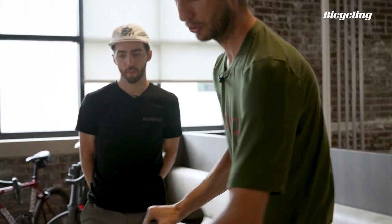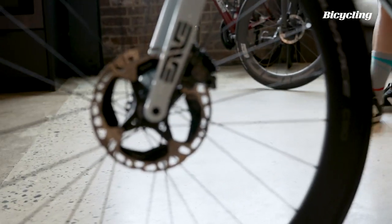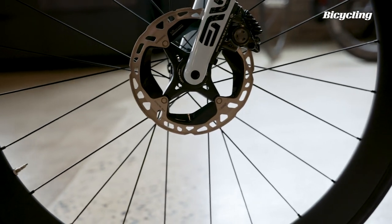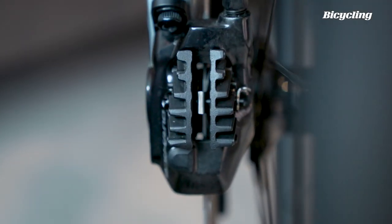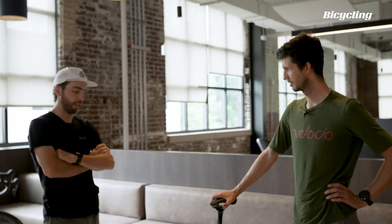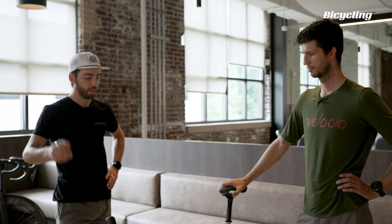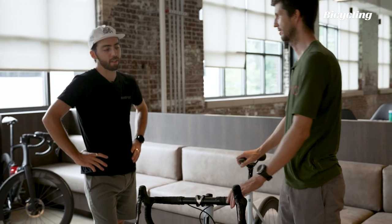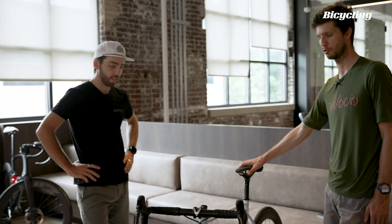The other big thing is the new brakes — the brakes are totally different. On Dura-Ace they're forged one-piece calipers; on Ultegra there are going to be two-piece calipers that are bolted together. The biggest thing Shimano has changed is they've added 10% more pad clearance. One of my biggest complaints when I first switched to Shimano hydraulic braking was on long extended or hard steep braking, the pads would rub pretty bad on the caliper at the end of braking. You'd have pinging sounds or wild squealing sounds — nobody wants to spend $4,200 on a group and then have it sound like a bucket of rusty nails.